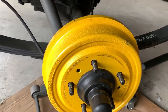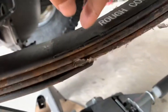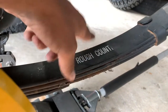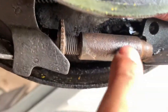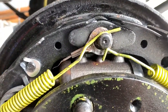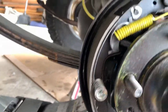Just to mention — it's a Rough Country lift, as you can see on the sticker. Put some spray paint and body liner under here because after sitting it starts getting surface rust again. Got the passenger side off now — this is the cable that broke. As you saw, we replaced this on the other side. We're going to replace the adjuster and the bracket as well. Basically, once the cable broke the shoes stay open, which makes it a little more difficult to remove.